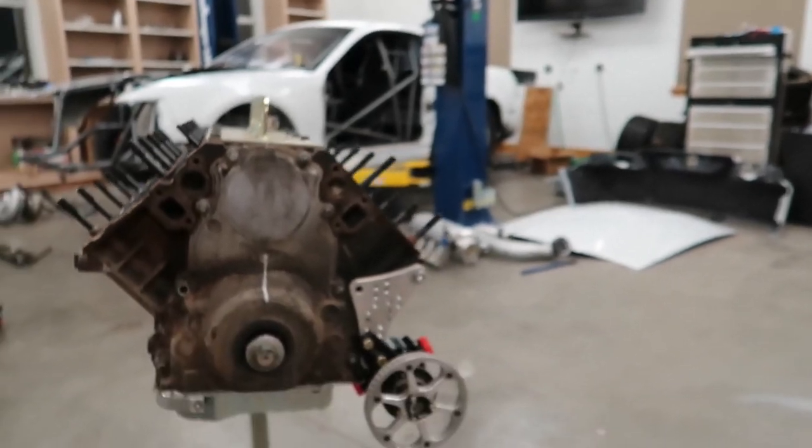All right, guys, so I went ahead and got this buttoned up. As you can see, just threw the front cover back on there for now. I need to run to the store, and it's too late now. Everything's closed, and I get some stuff to help clean off the deck surface in order to put the new heads and all that on, and then I'll probably have to check for piston to valve clearance because this is a pretty large cam compared to what we had in it before. So I have to check that, make sure we're all good to go there, and then that'll be all in the next video.